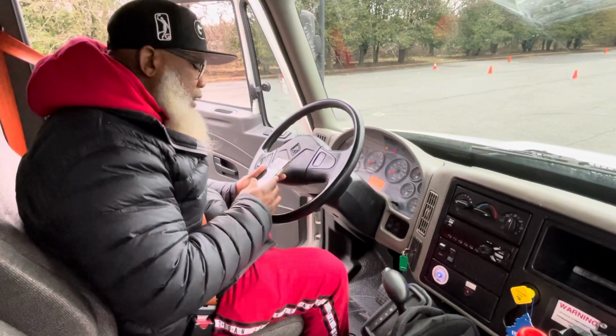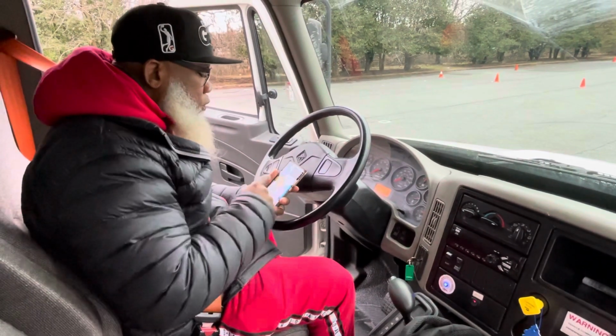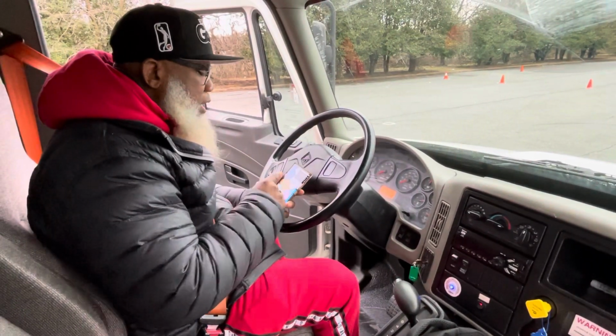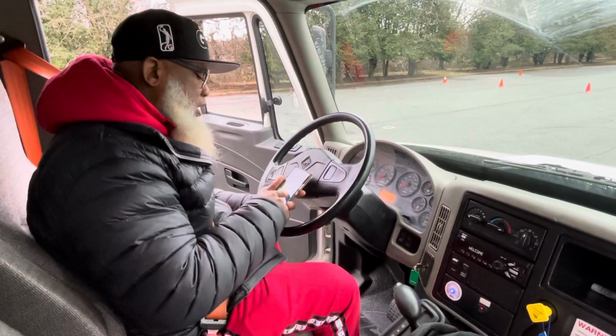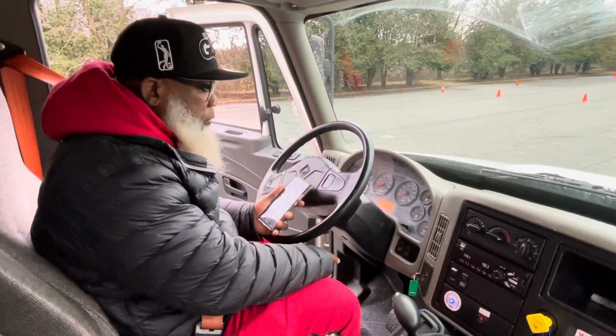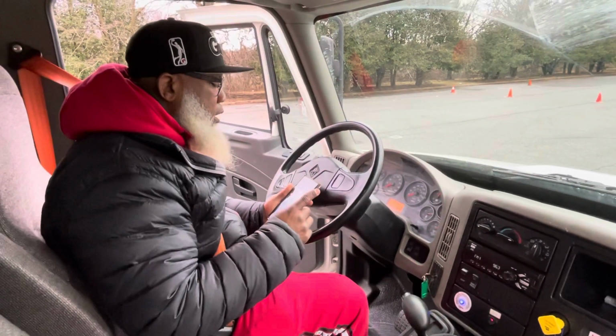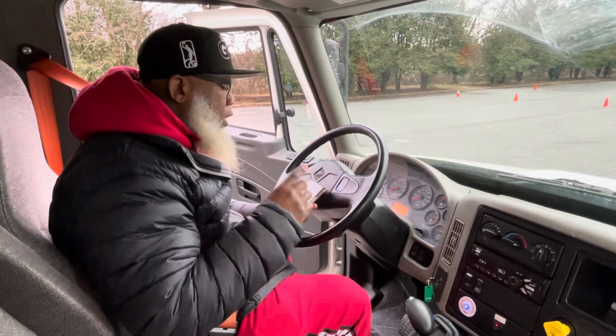While the air is settling, I'm getting my time straight. I'm at 3:56 right now. I'm going to wait till about 3:57 to begin, because I'm going to hold my service brake down for 1 minute, and within that minute, I should not lose more than 3 PSI.